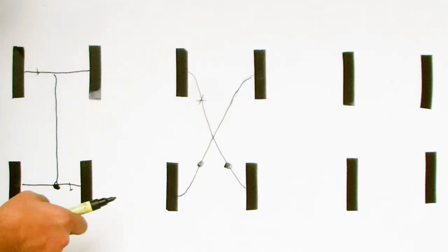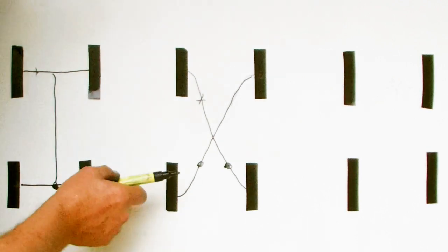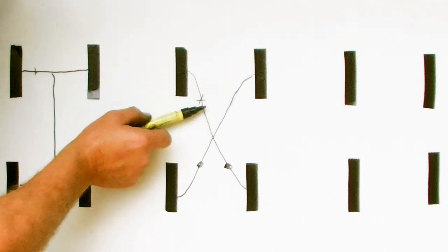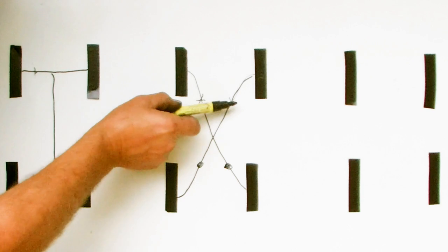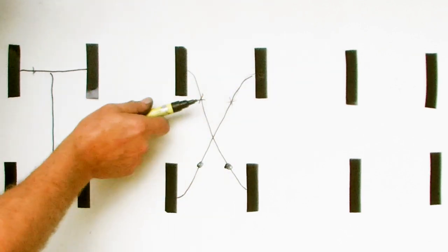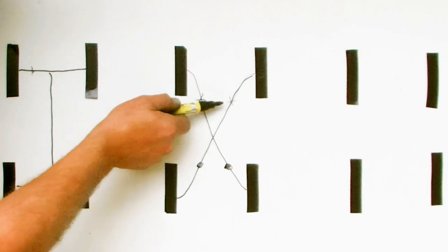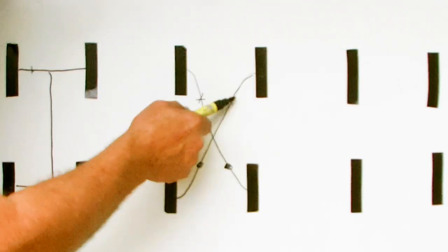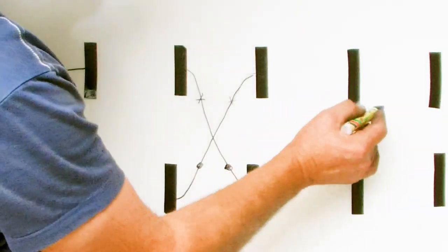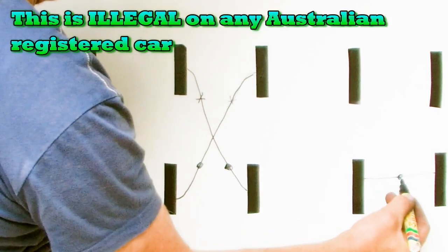On a circuit or rally car you want more braking at the front anyway. But I can't put a brake adjuster into the diagonal dual-circuit setup — you can't get a brake adjuster that works across two systems, and you can't put it on one wheel because it would make the other wheel go crazy. You can't have two separate adjusters either, because if one was set slightly different to the other, one rear wheel would lock and the other wouldn't — which would be dangerous.